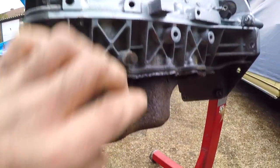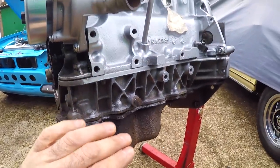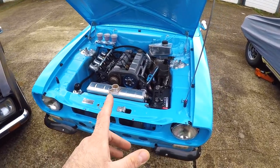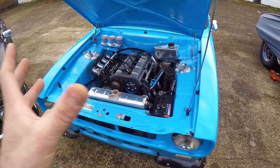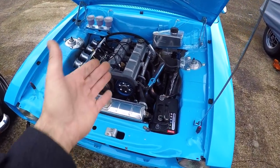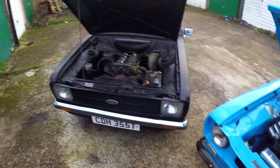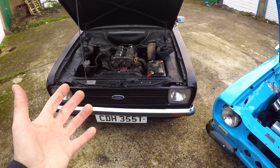The original sumps have this big lump of cast alloy with just a little steel pan at the bottom, whereas the rear-wheel-drive sumps bolt up higher so you do away with that cast section. That new cast alloy sump should be coming to market soon. Based on the measurements he gave me it looks really promising — when I was under Ester taking measurements it seems like it would fit a lot better than what's currently fitted. That new sump has also been designed to use a genuine Ford gasket, which should definitely stop it leaking, whereas the Neil Dunn sumps use a cork gasket, which is a very dated idea.